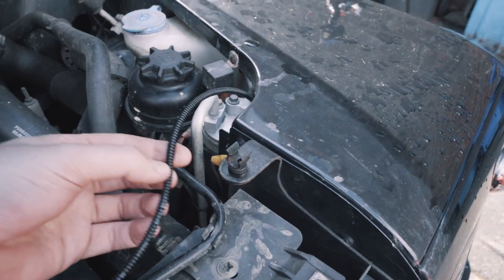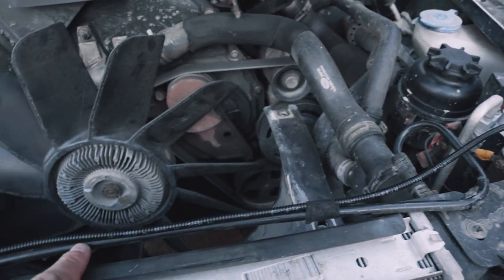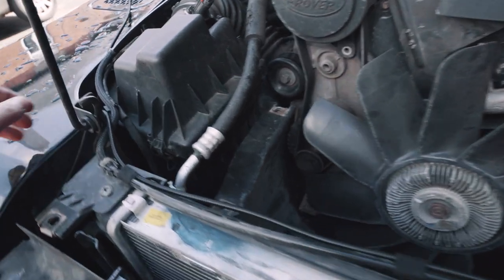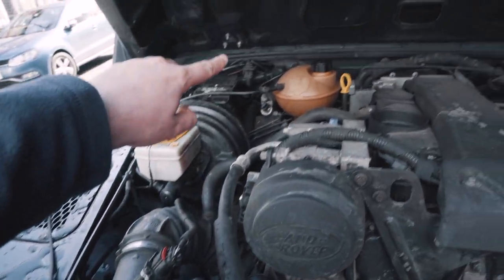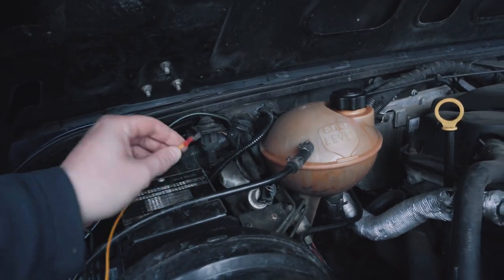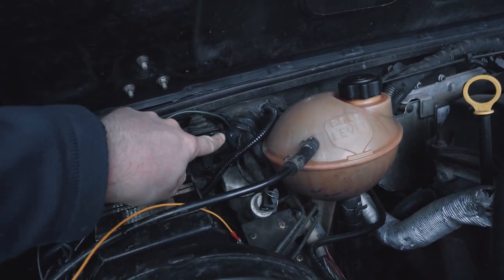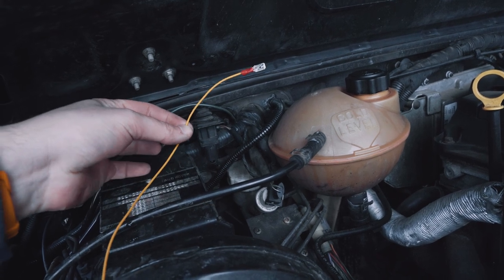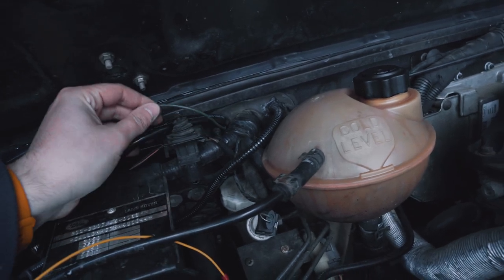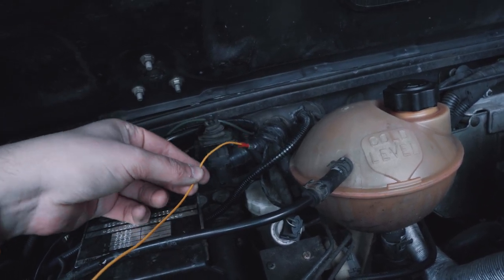That's all the wiring done to the back of the headlight. This wire runs the DRL connection across the top — I've used conduit tape to tape it to the factory wires so it's clean and out of the way, and the cowling will go over the top so you won't even see it. The wires then run up the side of the wing and through a grommet into the dash. To run the wire through the grommet, the best way is to get something sturdy like a piece of metal wire, push it through the grommet first, then attach the cable to it to force it through.